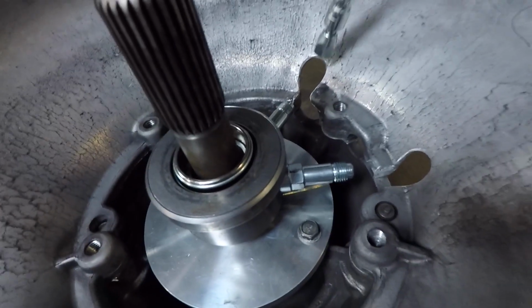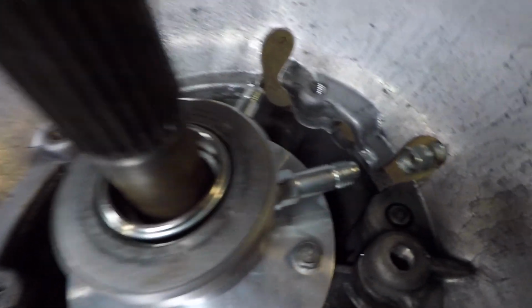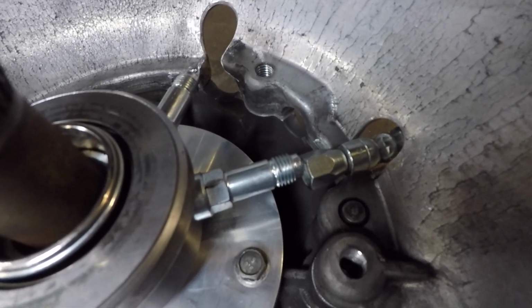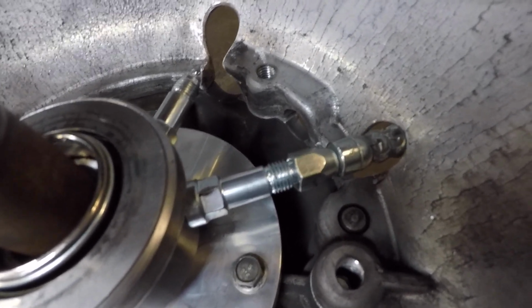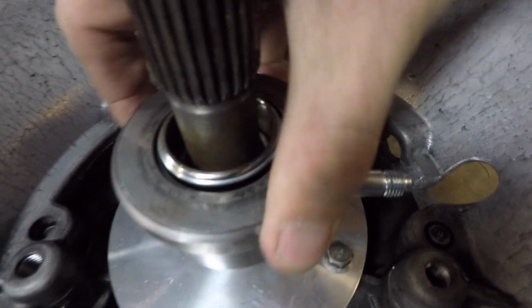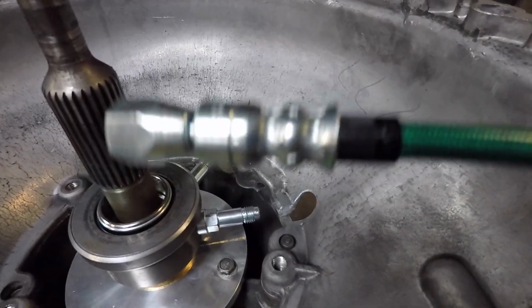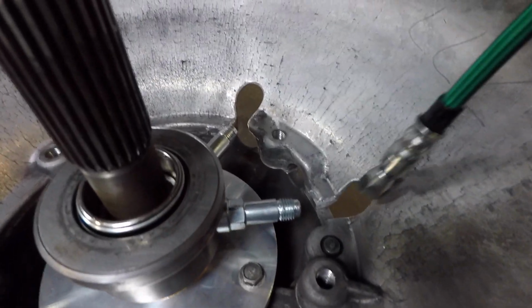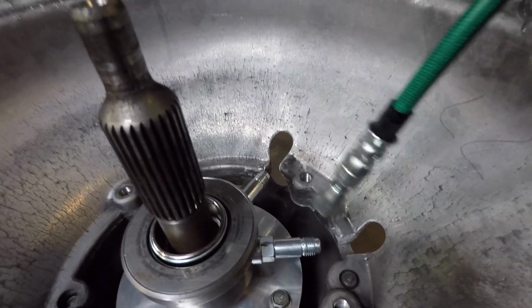Alright, so the torque tube's down and you can see the holes we have here. The problem is, and Eric already opened this up even more so that this could fit through, that we could probably screw it on, but these fittings actually travel with the slave, so when that goes up, that was nailing the line onto the bell housing right there, and that is what ultimately tore that off of the crimp. So we're going to take quite a bit more off of this, which does weaken the bell housing, so I don't like doing that, but should be alright.